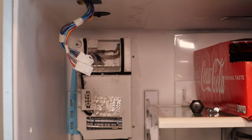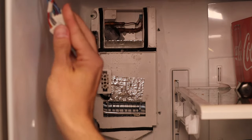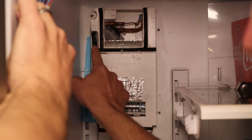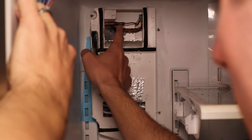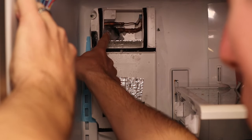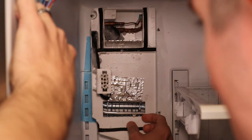We're going to go put this over here in the sink. This is pretty much down to the end of it as far as what we're going to do. Back here right where my finger is — this thing is all iced up. There's ice down this part, ice in the back over here, ice all in the copper wiring and stuff in the back. So that's pretty much what's going to be keeping it from doing its job. I'm going to go get a blow dryer and pretty much blow dry all this and melt it all off, and we'll go from there.